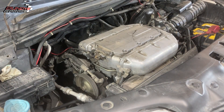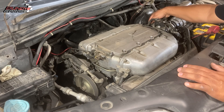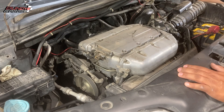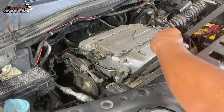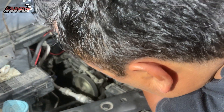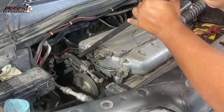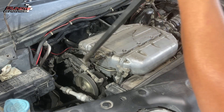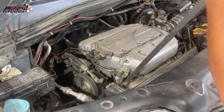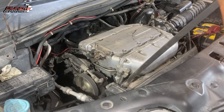You can see I got the cover off. Let me show you what it sounds like when I rev the engine up a little bit. Just a slight ticking sound. So let me determine where it's coming from. Got my breaker bar here again — checked the front valve cover, checked the back one. It's the back. I'm going to put my microphone up to this metal so hopefully you guys can hear it through the mic.